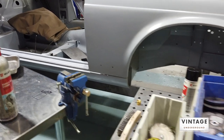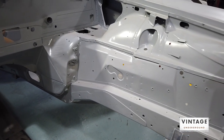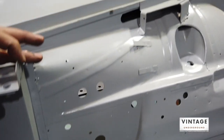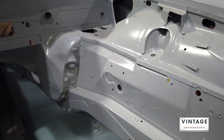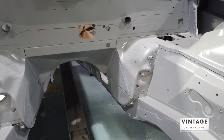After I get the back done, I've got a lot of metal work — just filling things and smoothing things to clean up. The engine compartment is just riddled with holes, almost more holes than metal. The firewall is actually pretty clean, but on the sides it's a ton of holes. I've built a '95 V12 six-liter for this, and that's already built. I've mated that to a T56 six-speed. None of that has been fitted in here yet — the V12s were originally in this car, so the motor mounts aren't a problem.